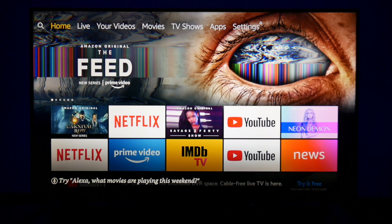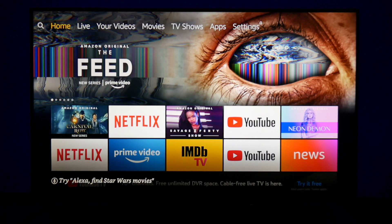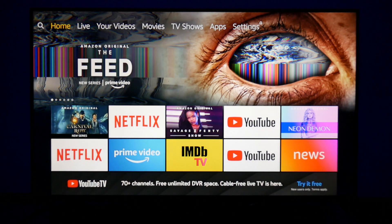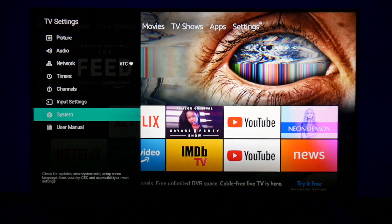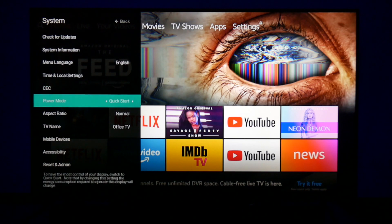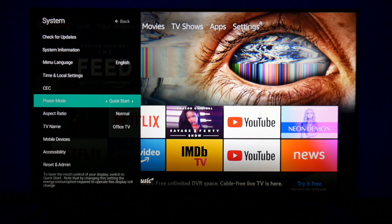When you first start making videos on YouTube, you gotta realize that some people — this might be their first 4K TV. Y'all that already know this information can skip through it, but it'll be quick and brief. When you first buy this TV, if you want to get the most out of it as far as 4K and HDR, the first thing you need to do is go into the menu, scroll down to System. Go to System and change the power mode to Quick Start. By default it's gonna be on some eco mode to save power, but it's gonna dial down the brightness. You will not be getting the high peak brightness out of the TV when it's set on eco mode. Put it on Quick Start so the TV can function at its highest capacity.